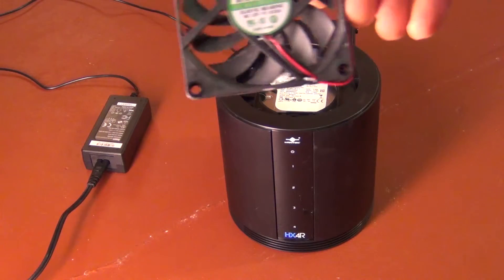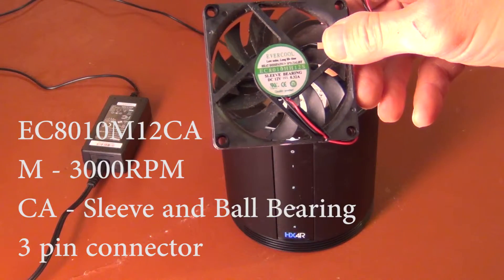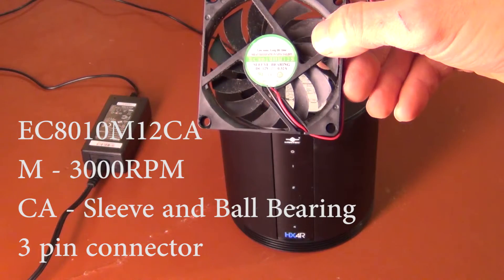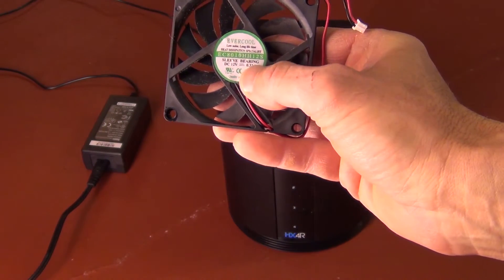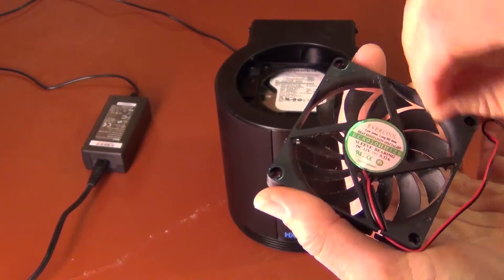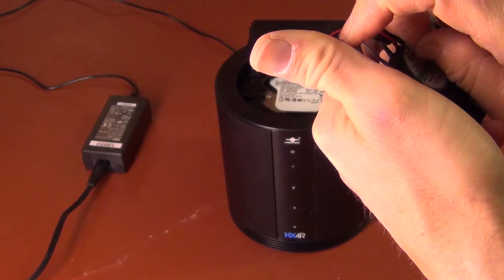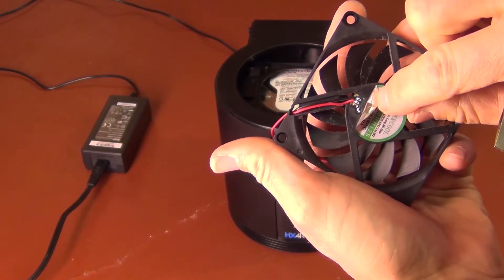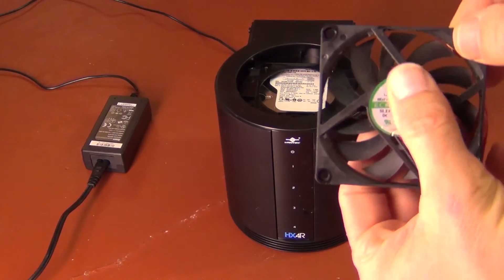These are the ones that are kind of noisy, and what I'm going to try to do is replace one of these. I haven't been able to find an exact match, but I did find an EC8010M-12CA, which is a little bit lower RPM — this original is 4000 RPM, that replacement is 3000 RPM. You can go to Evercool's website to find information about the different fans. The other issue is it's a two-wire connector here, and the fans I'm looking at have three wires. So I'm probably going to peel this label off, use a screwdriver, and desolder those wires and put this two-wire pin connector on the three-pin Evercool fan that I can find on eBay or Amazon.